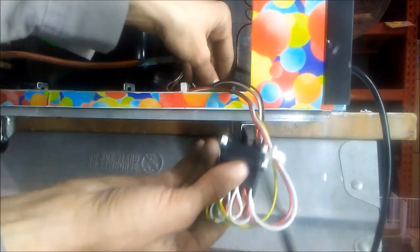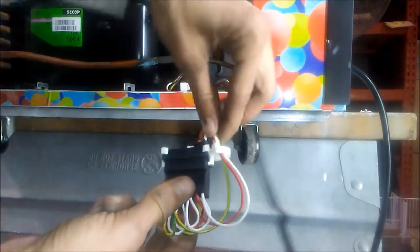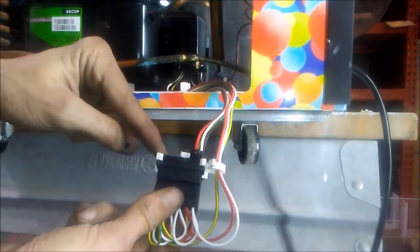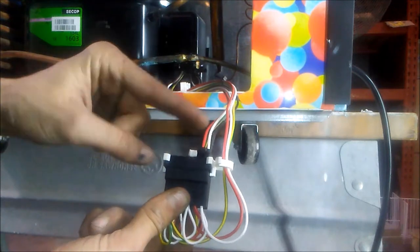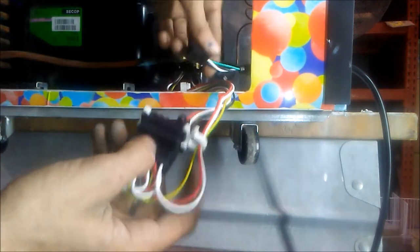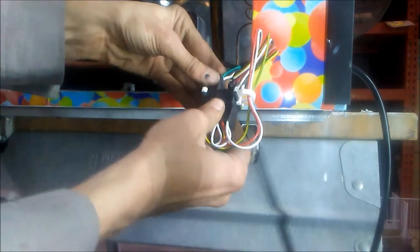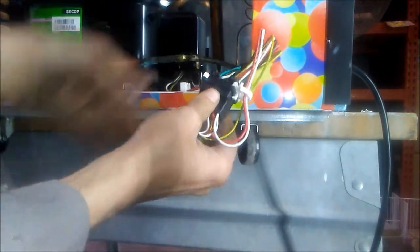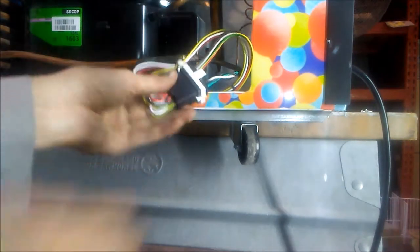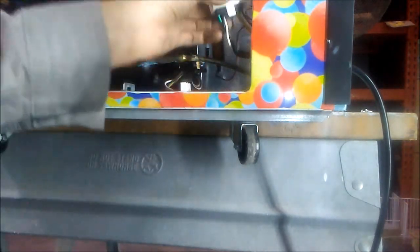Now that our power cord is installed in the back of the freezer, it's time to connect it to our Molex adapter. We're going to install it on the opposite side of the Molex, directly across from the wiring harness for our thermostat. Once the power cord is installed, we can then place our Molex adapter back into its original place.